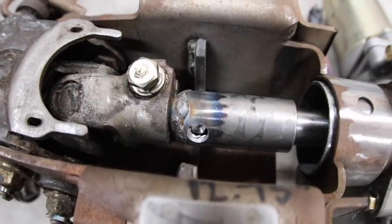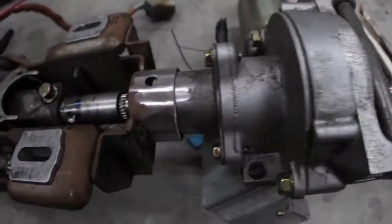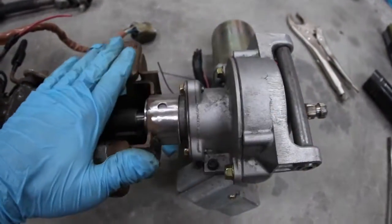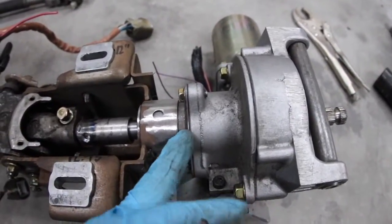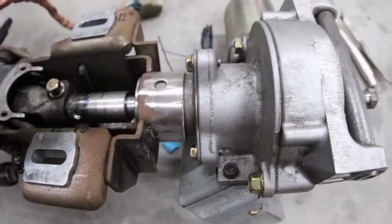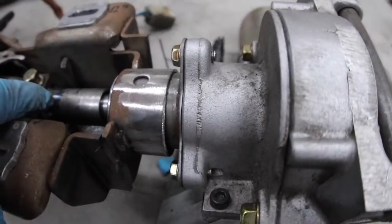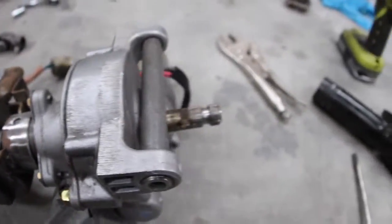I drilled out the plug welds but now I can't weld them because I'm conveniently out of welding wire. I just slid this in, maxed it out, bottomed out against the internal piece — it's going to be about like that relative to these flat faces. This is almost dead on but it's got some wiggle space, so I'm going to take this piece to a muffler shop and have them open it up. This flange portion's outer dimension needs to match the ID of this piece here for a slip fit self-centering connection. Once we get that done and get more welding wire, we'll weld those plugs, weld the sleeve, set it in the car, tack it, check it, fully weld it, and move on to the other side.